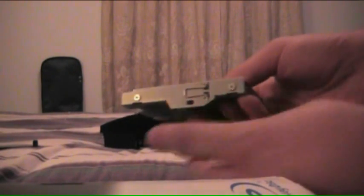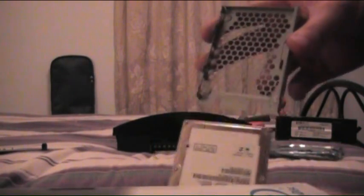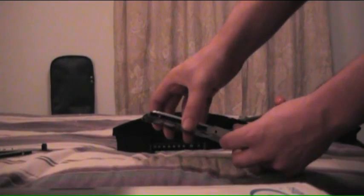The case comes off with four screws on each side — take those off to remove the hard drive. My original was a Hitachi 40 gig that came with the PS3. Once you get those screws out, the hard drive slides out one way — it pretty much falls out. Then set that aside, take out your new hard drive fresh from the packaging, and make sure it goes in the same way the original did, with the connectors facing toward the opening.